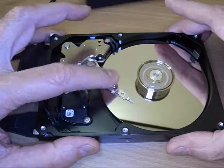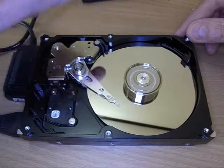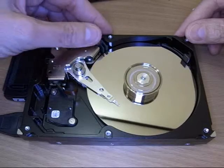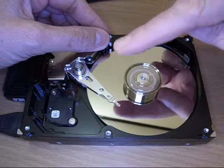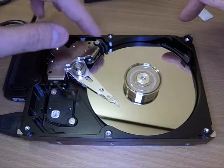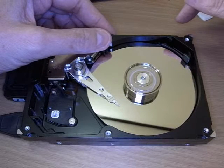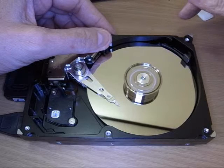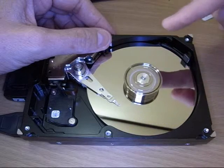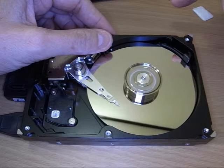There's the park position. I can dampen the head by touching it here. Or I can use this — this is a head lock, just a piece of plastic that touches the back of that arm. The arm goes back in here; it has magnets on it and they use electromagnetic coils to position it. I can quiet the screeching. As the disc goes around, the head is pulsing on and off and it sets up vibrations that you can hear. I'm just barely dampening them out.